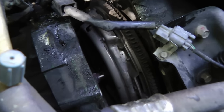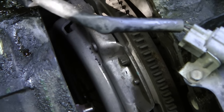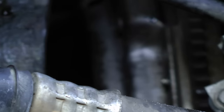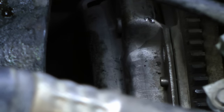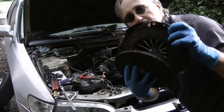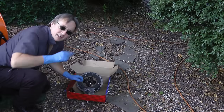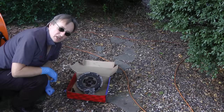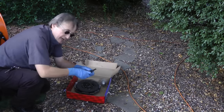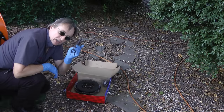There's the clutch plate inside the transmission. Unbolt the six bolts, pry the plate off, and pull the clutch pieces out. Here's a mechanic's tip: when you're changing the clutch, buy a clutch kit — it has all the parts you need and the little alignment tool to get the clutch in right.